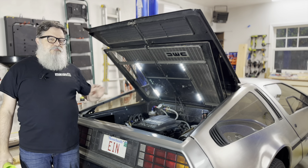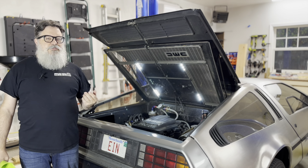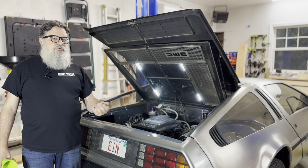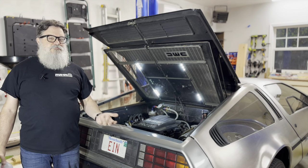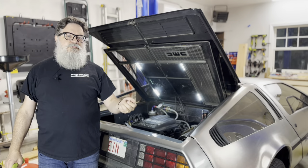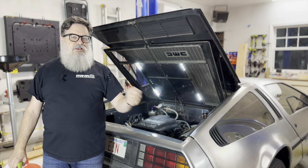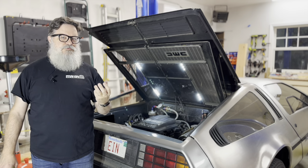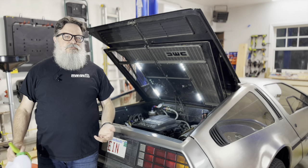There's a second bleed point up at the front of the car where you can get air trapped due to a local high point. Normally you'd have to disconnect a small coolant hose, wait for the scalding hot coolant to stop showing bubbles, and plug it back in — usually getting burned in the process. But there's also a kit for that, which I've installed, that adds a valve to the hose. You just turn the valve, wait for the bubbles to stop, and close it again. The valve does get hot from coolant running past it, so use pliers or hand protection to turn it. But right now I'm all set and good to go.